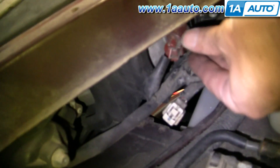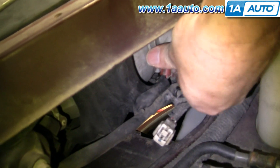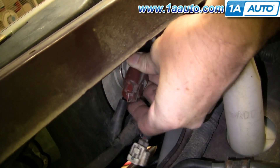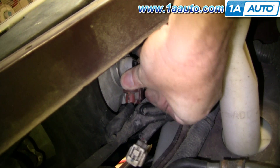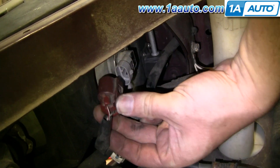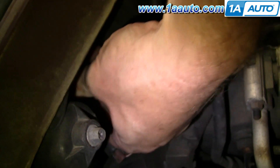If you're just looking to change a bulb, it's actually pretty easy on this car. You come right in behind, and here's your outside bulb. Twist counterclockwise, pull it out. Put it back in, make sure it goes in. Twist to lock. To disconnect, you just press a tab here and disconnect. Same thing over here — press the tab, disconnect, twist it counterclockwise. The bulb comes out, new one back in, push it in clockwise to lock, and then reconnect.